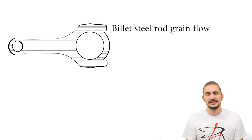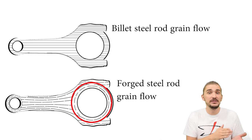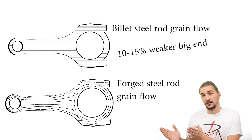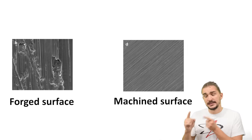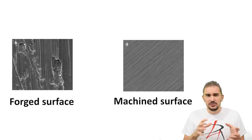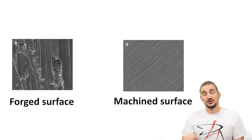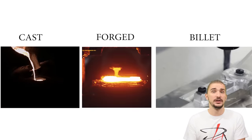There is a minor downside to billet rods: they lack the circular grain flow found in the big end of forged rods, meaning the big end of billet rods is about 10 to 15% weaker than that of forged rods. However, billet rods lack the surface degradations present in forged rods that occur during forging, meaning the material has the same carbon content and quality both in its core and on its surface, making billet rods better at resisting crack formation. These three manufacturing processes influence the strength of the rod to a great extent.